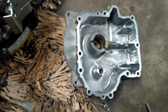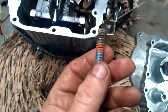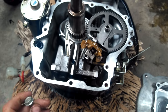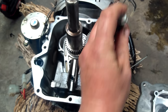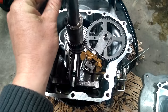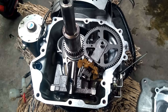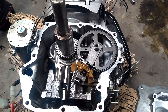When you lay down your gasket and sump plate, make sure everything is nice and clean. Clean the bolts up with carb cleaner, and you'll need some medium-strength threadlock. When you put the plate on, use common sense with the bolt sequence — put a bolt here, here, here, a slight squeeze, then tighten diagonally. Keep tightening in that diagonal pattern a little bit at a time until you get a good squeeze on all the bolts.